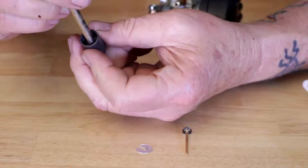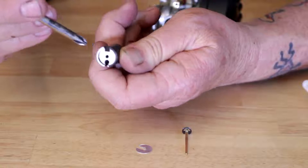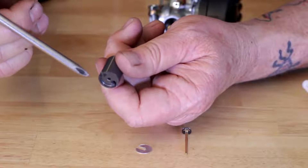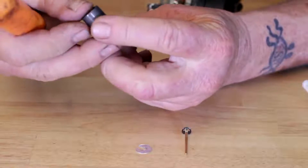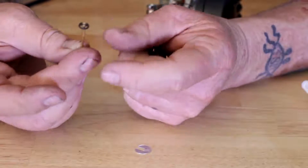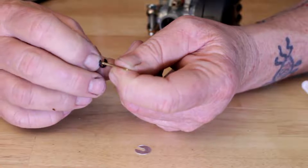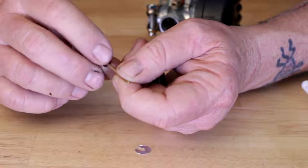The cable goes into the bottom — you've got this area where it goes in, and the bottom is pretty much flush. You've also got this little notch here, and that notch is where your idle adjustment screw hits. So the bottom has the notch cut out. Your needle has four positions.